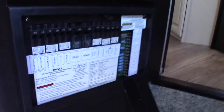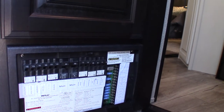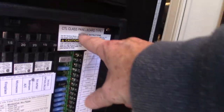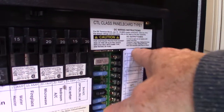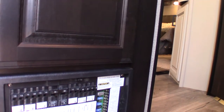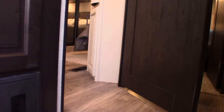The power inverter in the front compartment takes 12-volt DC and turns it into 110–120 AC. This is the power converter — it does just the opposite, taking AC power and turning it to DC. You have regular 110–120-volt circuit breakers here, just like you'd see at home, all labeled. The power is then converted to 12-volt DC — you've got 12-volt fuses, all labeled. The blown fuses will actually light up and you can see them through this tinted plastic. The 12-volt power that it converts also goes to the front to charge both batteries, so as long as you're plugged into shore power, this converter will keep your 12-volt batteries charged.